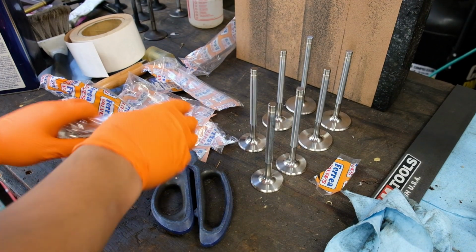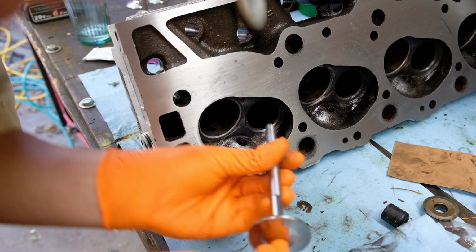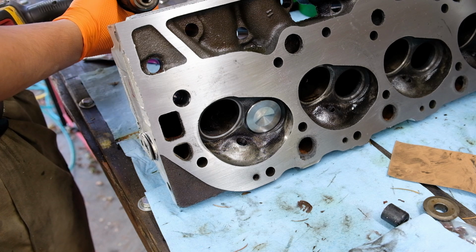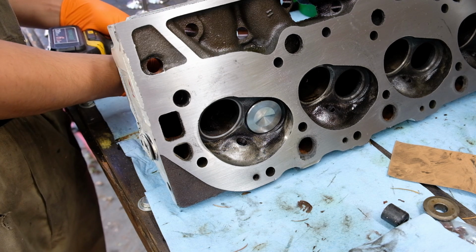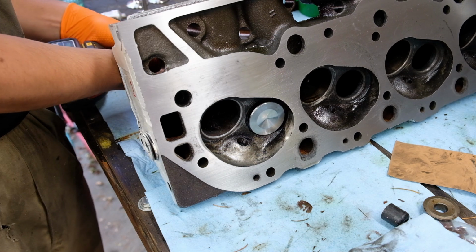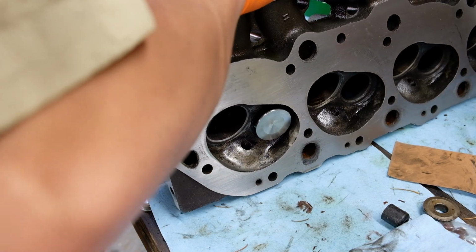This being a Mark IV motor means it's the least desirable for performance, and the valves are certainly no exception. They're a cheap 2-piece welded valve that are apparently known to fail even under stock spring rates that'll give you valve float about 1000 RPM before the stock redline. So I figured I might as well replace them with a set of Ferrea stainless valves in the stock size.